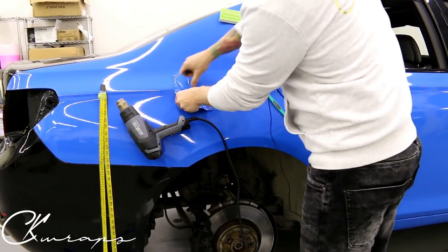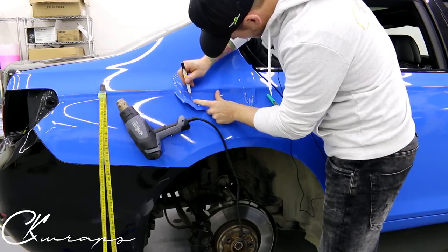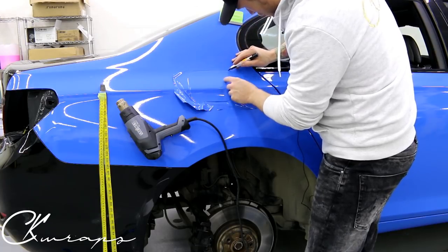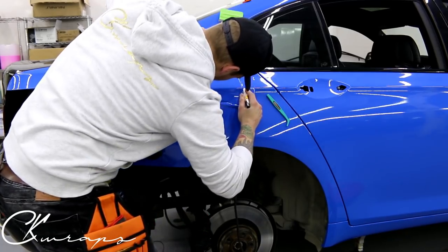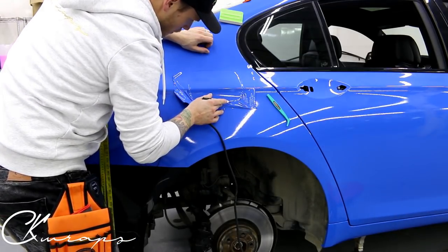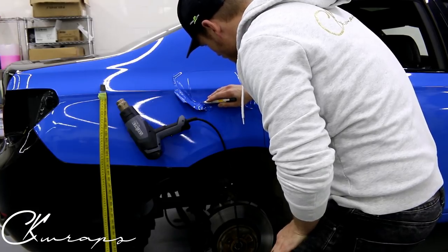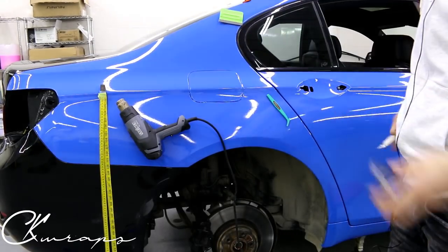That's a little tiny trick. For those who just want to wrap your doors or gas tank in carbon fiber — perfect, you can do it really nice and impress all your friends. From here I'm just going to trim on the outside, on the quarter panel side. Want to be a little careful because we've already wrapped it. Find a guide, get your 30-degree blades — I find they're the best. The reason why we cut on the opposite side is that it's more or less a guide.